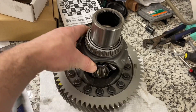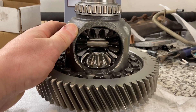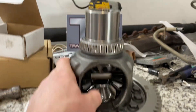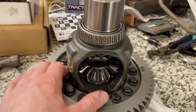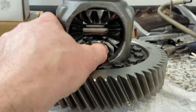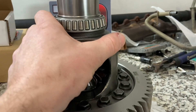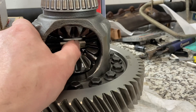This here is a GM 6T70/75 front diff, and the reason it's sitting here is because this particular LSD kit is specifically for this diff. This is the GM cousin of our Ford transmission, and beyond it looking the same I decided to buy it and took some measurements. The housing, axle gears, spider gears, and shaft pin are all the same.